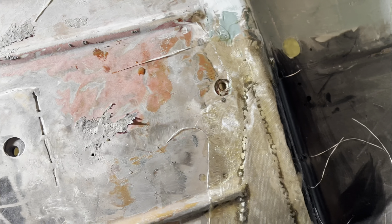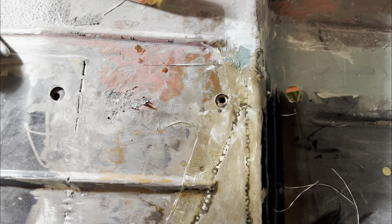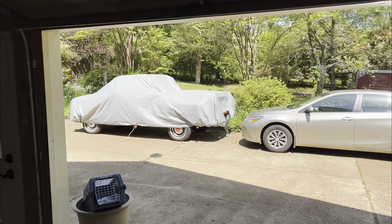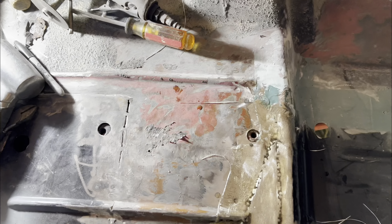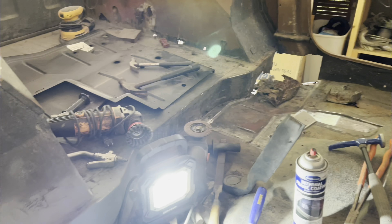What I just did here is I flapped that down to bare metal for the most part. You can see that slit that I cut out when I was pounding on it to try to reshape that fender. Got two coats of fiberglass with the cloth on this side. That light shows you how wide that is in there — it would probably be okay to go ahead and fill, but just as additional support and backing, I'm going to fiberglass this side as well, probably two coats with the cloth. That'll get it sealed up, and then I can undercoat this side and start doing body filler to finesse that panel.